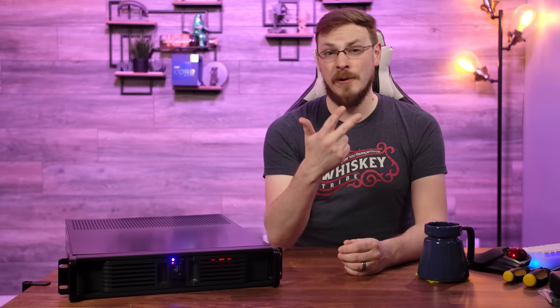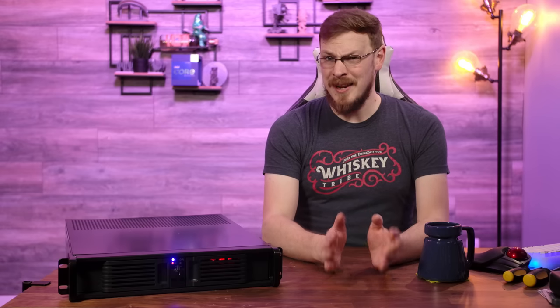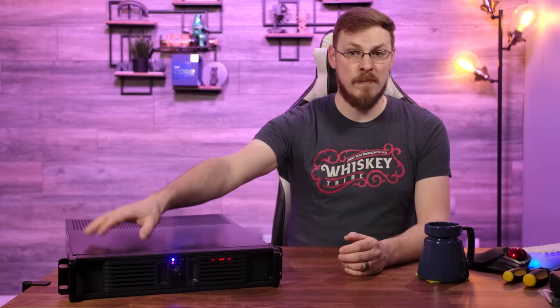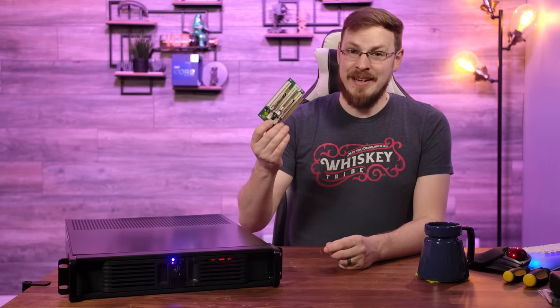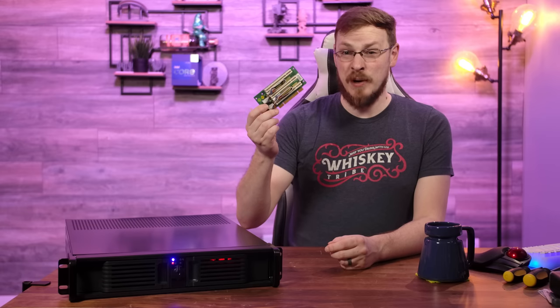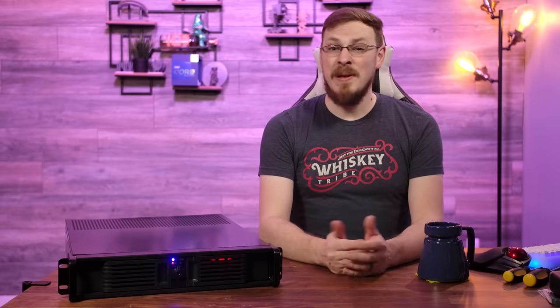Overall, the layout of the iStar D200 chassis is pretty good — room enough for two hard drives, a full ATX motherboard, three full-height PCI slots, plus five-and-a-quarter and three-and-a-half inch bays up front. Opening the box, it's easy to tell this server is from a bygone age, as there's no ventilation in the top cover for the power supply, and included inside was a three-slot PCI riser — not PCI Express. Being built in 2009, this case was likely destined for something like a 5400 Series Xeon, not a Ryzen 7 1700 and a 1070 Ti. But in the end, everything did manage to fit without much issue.